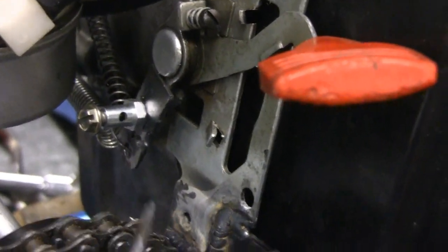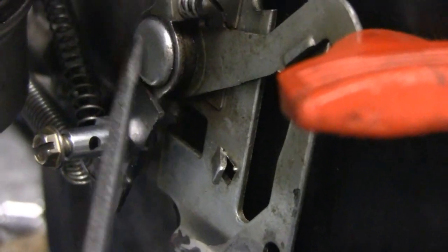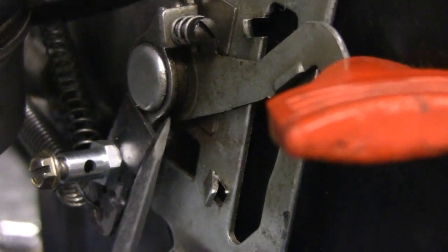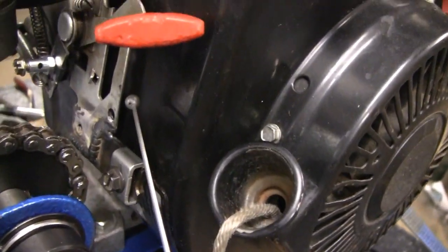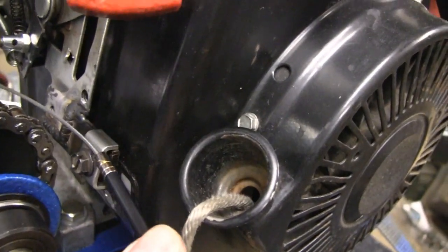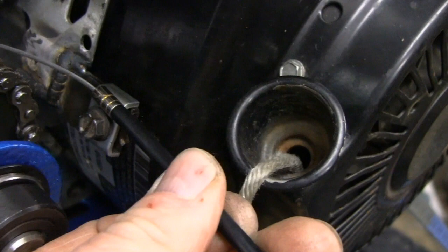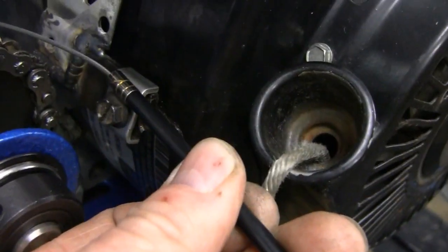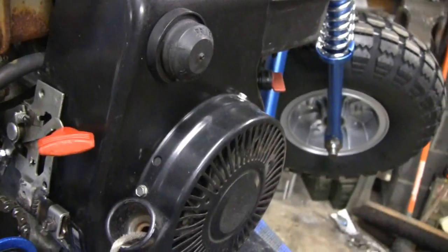It's a little tab — only about an eighth inch wide — and he welded that on there for me. I'm going to have to cut the ball off of there. Where the ball is at the end of the cable, it'll go through there. And then this little end here will clip onto this — we call that a conduit clip, because they call it the cable conduit. And then we'll just hook the throttle up and that'll be almost ready to go.